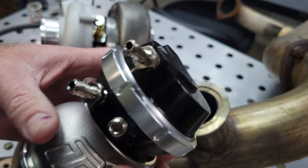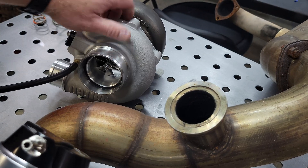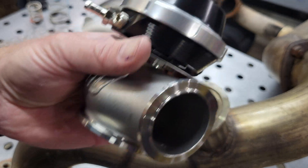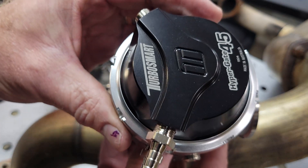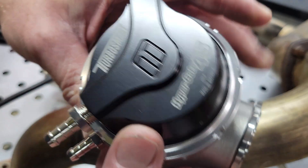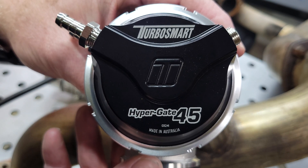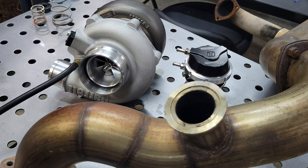Super simple, super straightforward — bottom port of the gate straight to the compressor cover. That should give you your base spring pressure. The next video, I'll go over a simple manual boost controller installation and then we'll go on to electronics. If you have a suggestion for a video or need some help, drop me a comment down below and I'll be happy to try and take care of you on a one-to-one basis. I appreciate you — y'all have a wonderful day.